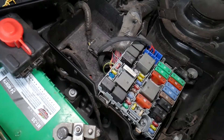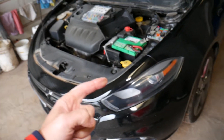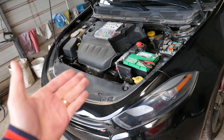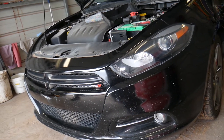If you guys have problems, this is the fuse that you need to check. If your car still does not start, you have a fuse for a starter, a fuse for a run-start relay, and a few more fuses for the engine computer. We also have a video on how to test the starter. All that will be shared on the channel to save you guys money — so take advantage of it.